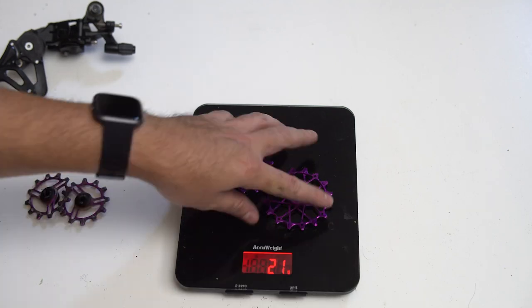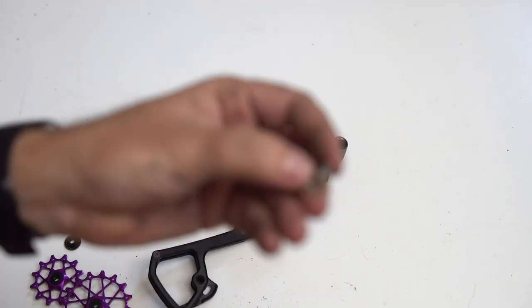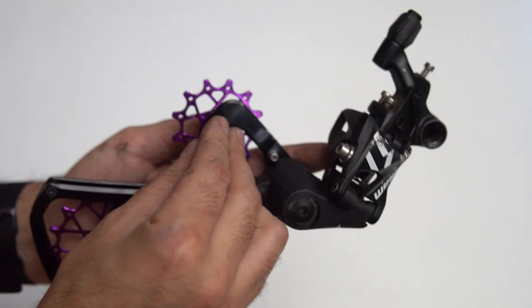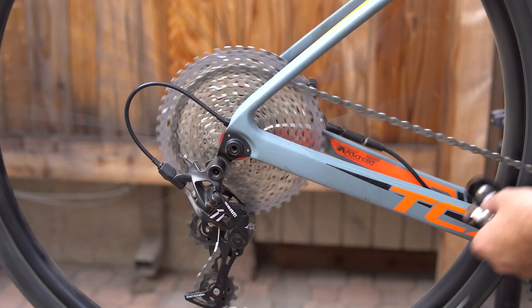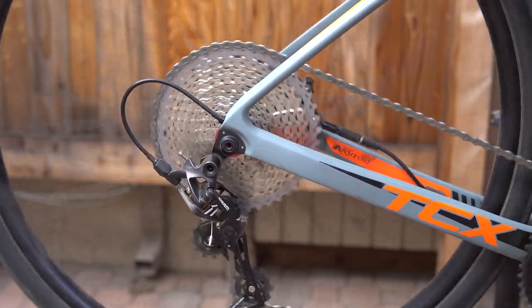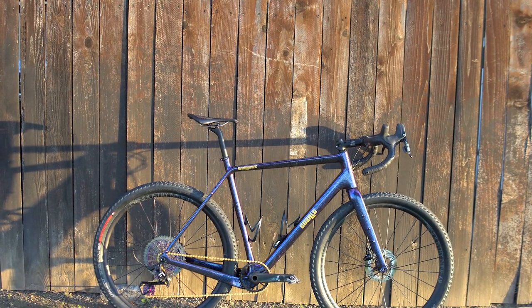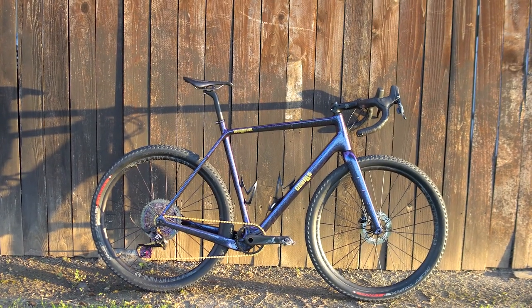Since this is a full replacement, it does extend your rear derailleur max tooth capacity. The long cage that comes spec'd on any of these SRAM 1x derailleurs is going to be a 42 tooth max cassette. I have done this with a 46 tooth — I'll link that video in the description — on a stock derailleur with no problem, but it definitely was a little stretched and didn't shift as well. When I wanted to make my monster gravel bike build featuring my Cobalt Warhawk, I wanted to go up to that magical 50 tooth cassette and find the best, cleanest, lightweight, and aesthetically pleasing option.